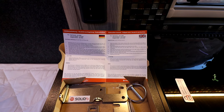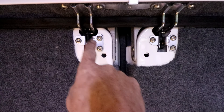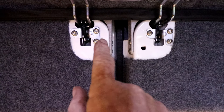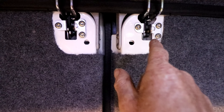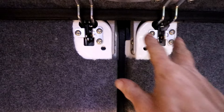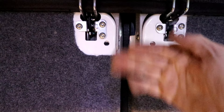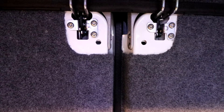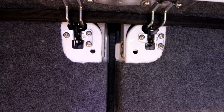At the top of your barn doors you've got a section with three bolts in it, and the same on the other side with three bolts as well. We're going to be removing two of these bolts on this side and two on the other side. Basically this kit fits across the doors and the locking mechanism fits in the middle, stopping the doors from opening if somebody attempts to get through the standard locking mechanism — it helps stop the doors from being pulled open.